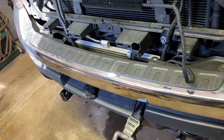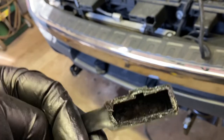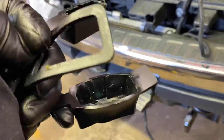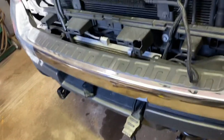But the biggest thing is when your plow's on and these things are just hanging there, the cover just fills with sand, salt, water, and brine. Then when you take your plow off and go put these covers back on, you're introducing all that junk into the electrical connections.